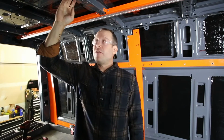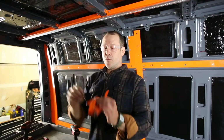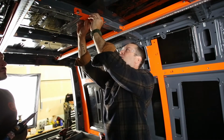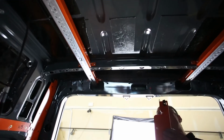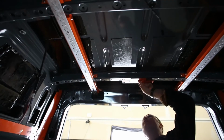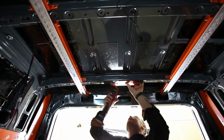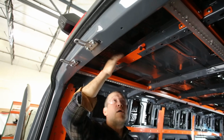Now, if you're going to put the fan in the rear position for the Adventure Wagon kit, it is in this 6th bay. So this next piece goes just like it did around the fan on the first one, where it is facing away forward of that 6th bay. The last one will go on the aft side of the very last rib. And you'll need your shorter angle drill or whatever setup you use to install these tracks to get into that space. All right, with that, we're done with this step.